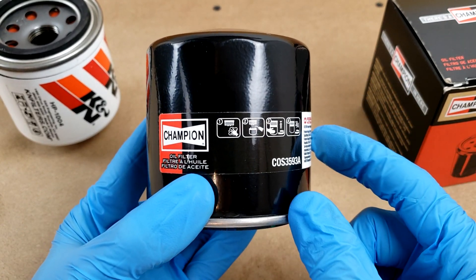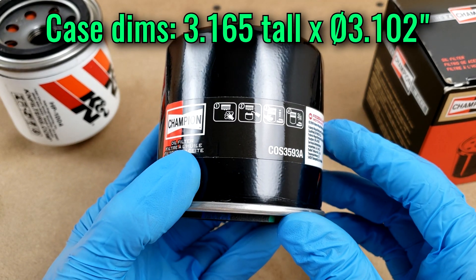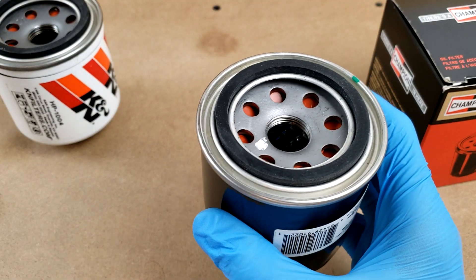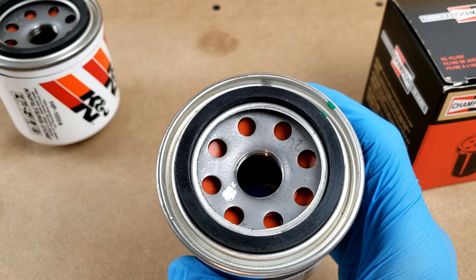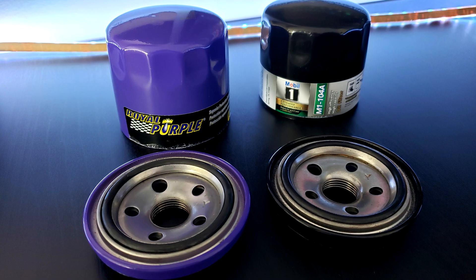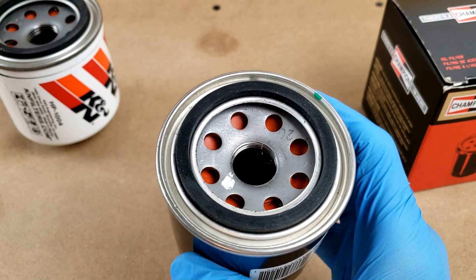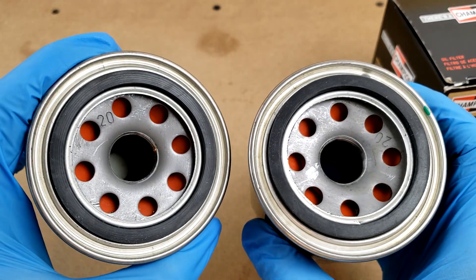Filters for this application range from about 220 grams to just over 350, and this one falls in the middle at about 298 grams. On the underside, the combined inlet area of these eight inlet holes is about 0.53 square inches, which for reference is nearly twice that of a crossover Mobil One or Royal Purple. The gasket is made from silicone and it appears to be identical to what you get on the K&N Performance Gold, and the similarities don't end there.